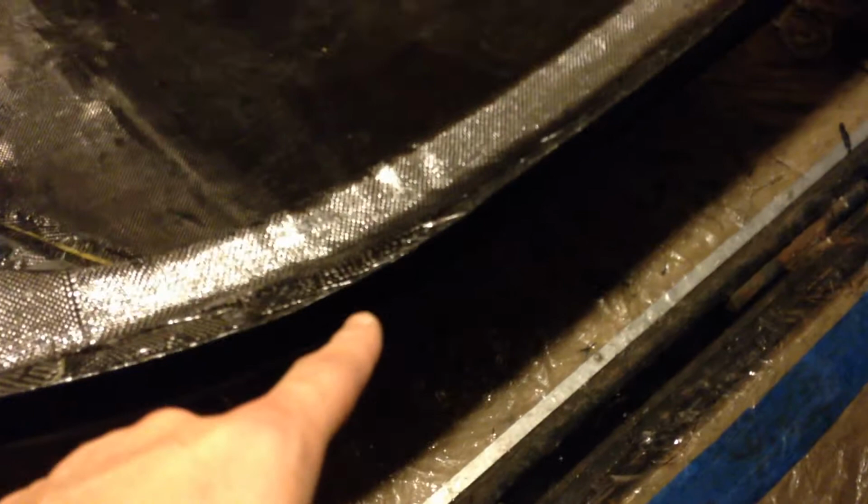And what Tom Tabor and Erica and Matt primarily did was put 3 more layers of reinforcement in the nose where it's going to get the most aero load, because this one's going to Germany. They also very smoothly blocked off the front air dam, improving the aerodynamics of this guy. So they have a layer of carbon that they've added, perfectly smooth, and then a layer of biaxial mat to add thickness, and then another layer of carbon. And there had been a crack in the front, but it's now been repaired and is 4 times as thick.